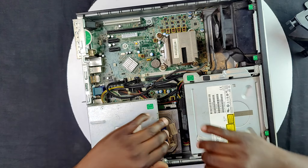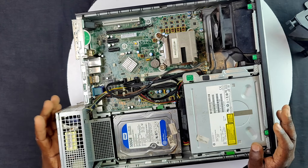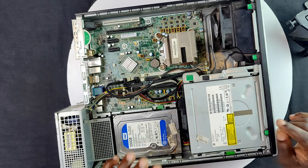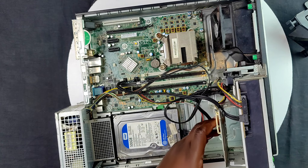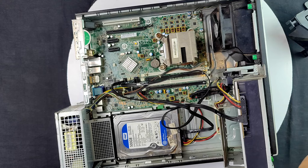Next, let's take this a little bit apart. If you notice, this here is your power supply, and this here is your hard drive — an ordinary mechanical hard drive, which is very slow. So we're going to have to upgrade that. Also, if I lift this up, you'll notice this is a DVD-ROM. When was the last time anybody gave you a physical DVD? So I'm going to be using these connectors to upgrade to something else.